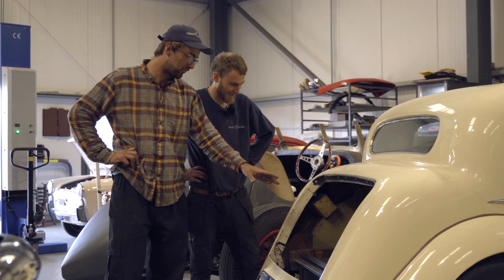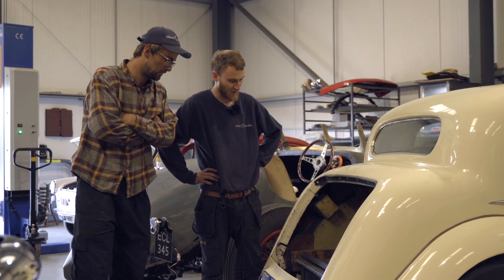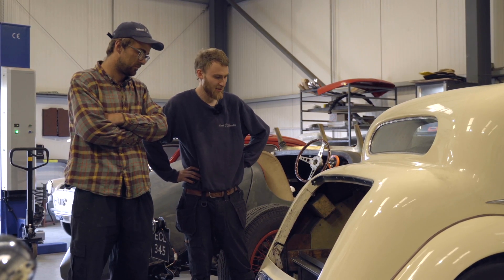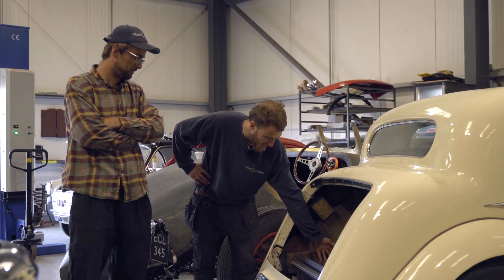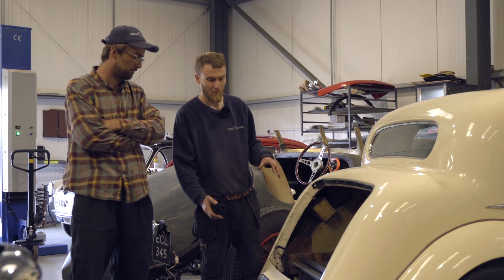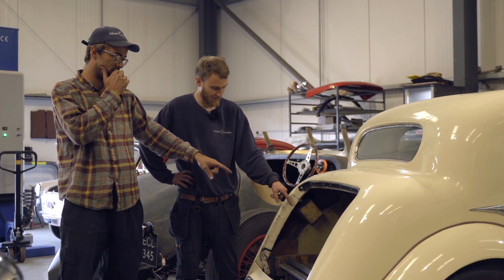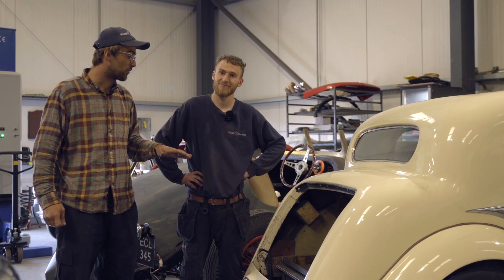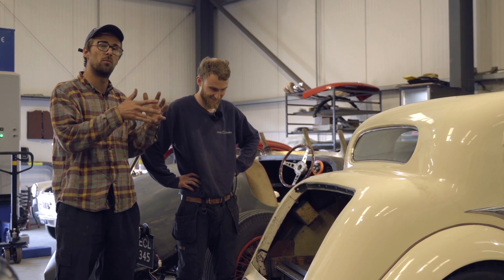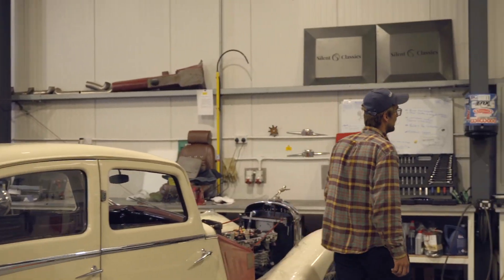There was plenty of space but not all in the right places, so we've had to split it up into two battery boxes to get the pack we need for this application. There's a bottom battery box mounted in this frame, and then another battery box on top for the rest of the batteries - because if we made one box we'd never get it through the boot aperture. We're using VW ID3 modules in this car, 12S configuration, and there are seven modules total. We'd love to do it all in one box but it just wasn't possible.